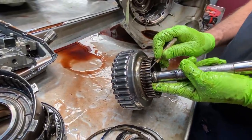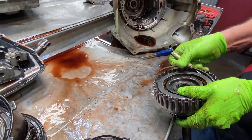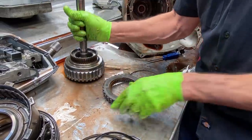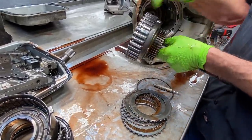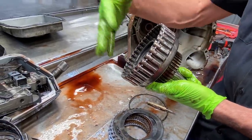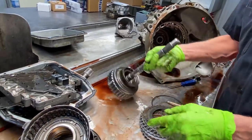We have our forward drum seals here — there's two of them. You have to have a sizer to put them on. And then you have your forward clutch. This transmission is bad about high line pressure problems — it breaks things and cracks. One of the biggest issues is blowing this snap ring groove plumb out of this drum — it'll bust it all the way around, you can just take the top piece off, or it'll be sticking out like that and the forward clutch will be all burnt up. But that's from high pressure.